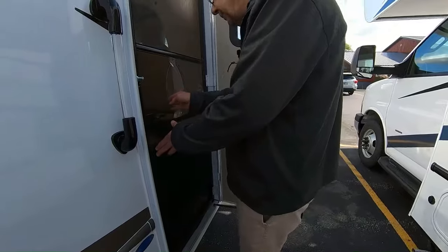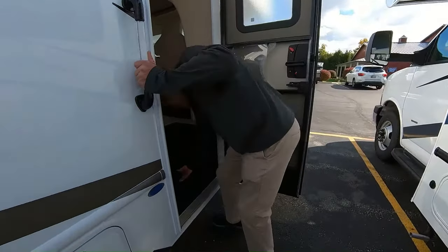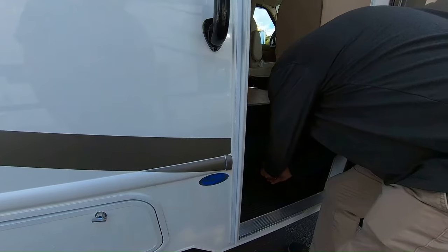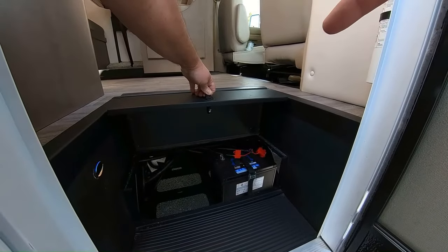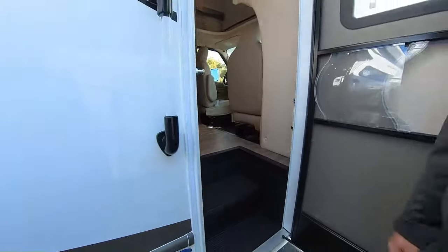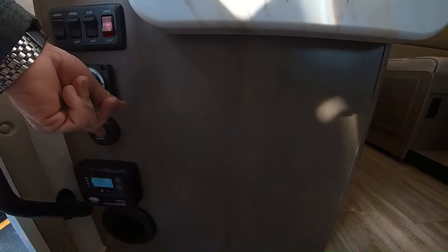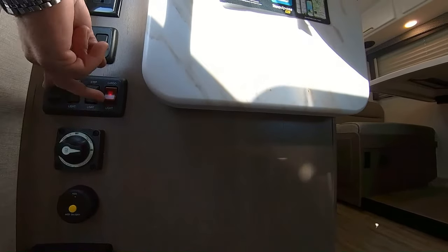Here you have your screen door, which has a little plastic part you can pull over to prevent bugs from getting in while still having some airflow. Down here is where you have your house battery — and you do have room for another house battery on there too if you want. Then as we come in further, there's your solar controller right there. You do have the auto gen start, which you can set up so that if your voltage gets low, it'll automatically kick your generator on and charge your coach up. Here's your battery disconnect — when you're not using it, just turn it to off and that'll help extend the life of your house batteries.